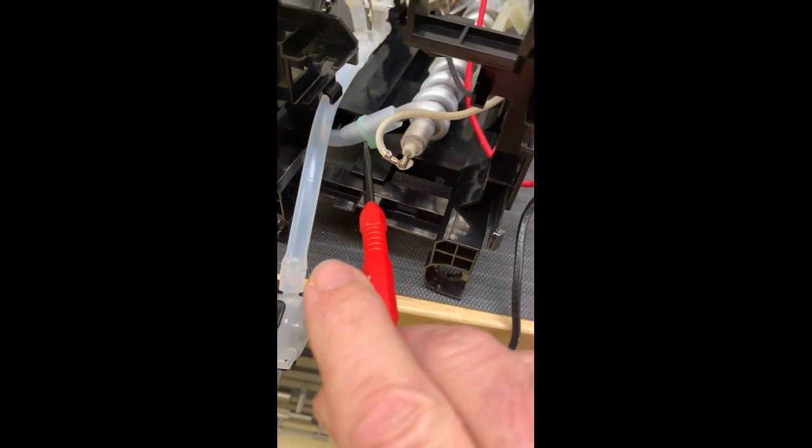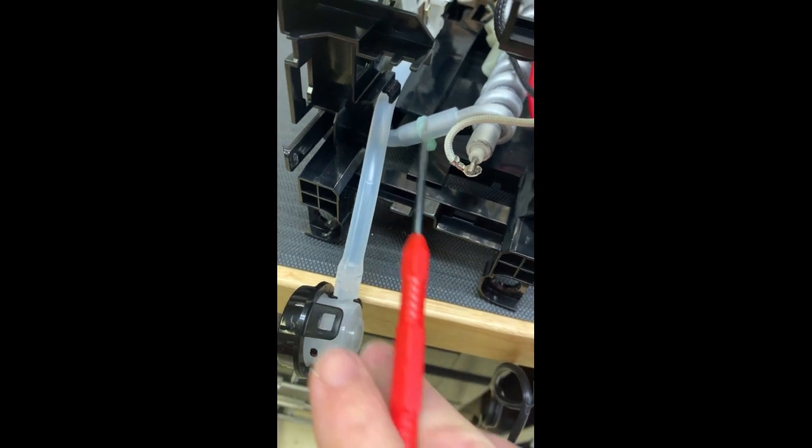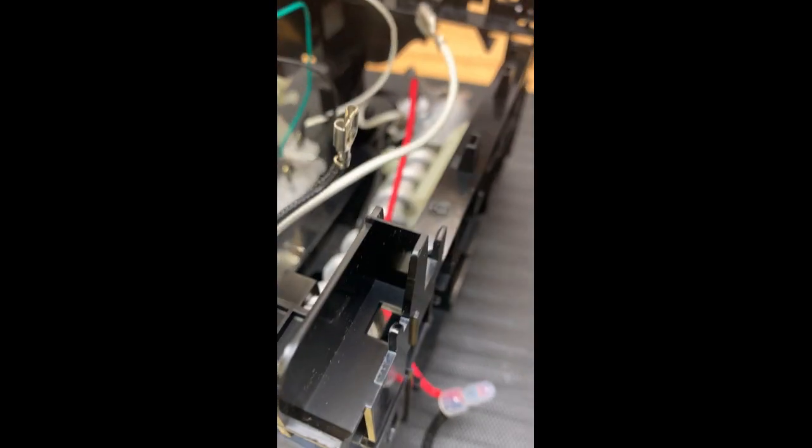So if it gets too hot, it turns it off. Here is the element, the power going into the element here on the positive side, and the water inlet here. Actually, this is the hot water outlet that goes to the needle in the pod. And then on the bottom of it, you see this is the inlet tube coming in, cold water inlet tube after the pump. And this is the bottom, this is the neutral wire for the heater element. So that's basically what we're seeing.